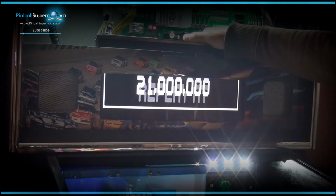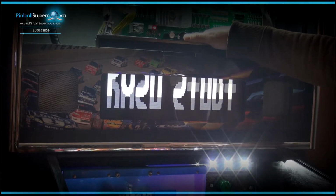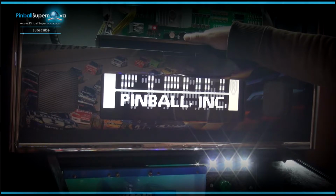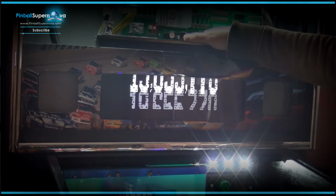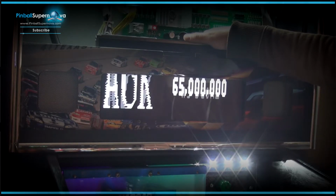Okay, so everything is back together again, and now you can see that the DMD is all distorted and you can't really read anything, because we need to set it up to the correct pinball machine. Basically, they have the Whitestar, you have the SAM for Stern, meaning the two Stern models, and then you have the WPC 95 and the regular WPC. These have to get set up for, because they all get the displays set up in different positions for the different machines.